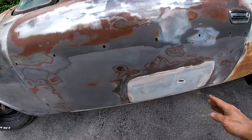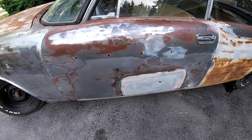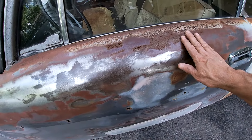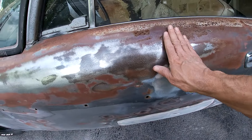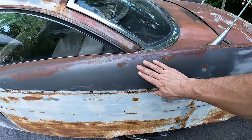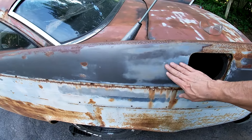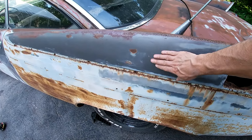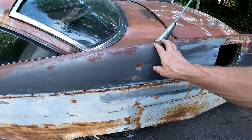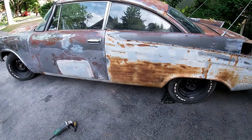Some all over here, some down there. So I think this fender's had some major work over the years — how much, I don't know. There's this giant blob of Bondo. It's pretty thick. I'm going to actually grind it out with the grinder. I think what I'm going to do is try to find something a little more aggressive to remove this paint and a lot of this pitting. When he left this bare metal or whatever he did, it just pitted to heck. The kid and I wet sanded this with some wet sandpaper a year ago or so just to get the silver off because the fins were silver, and it revealed nice original paint underneath.